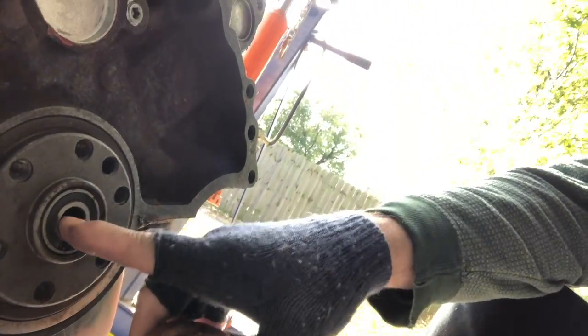Maybe the seeds in there won't help, I probably should have just got good old Wonder Bread. But anyway, we're gonna give this a try and see if we can cram this hole full of bread and allegedly this thing pops out. So if that pilot bearing comes out, there'll just be a little bit of bread to scrape out of there and we should be good to go. UPS is dropping off my new pilot bearing today, so we can get all the bell housing, flywheel, and block plate put on.